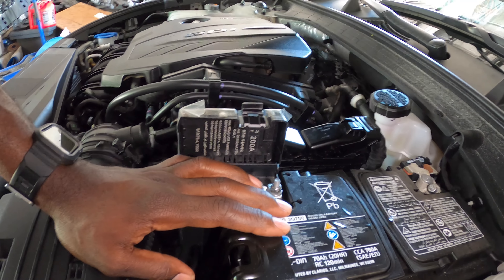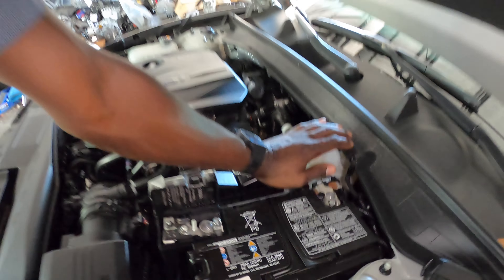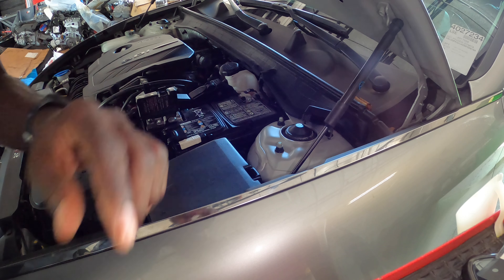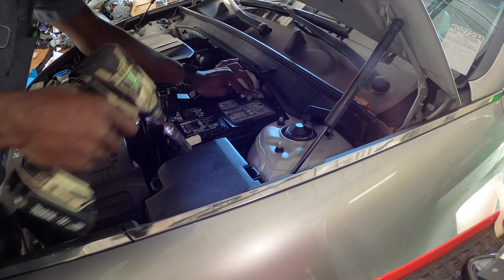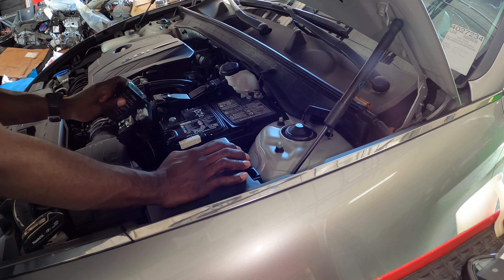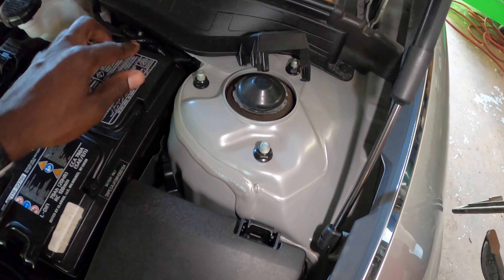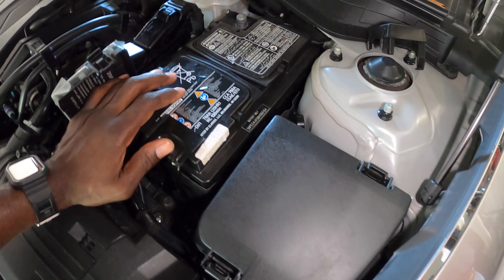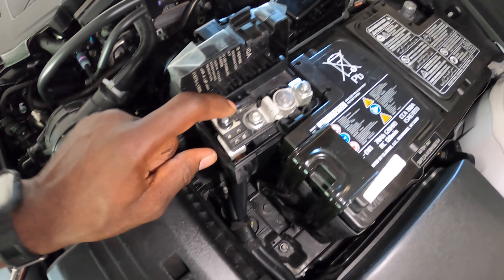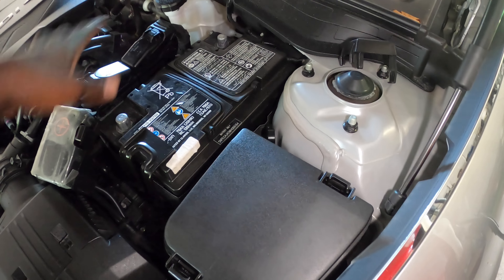If you're really careful you can take off the positive terminal first. But if you don't feel like being really careful, you can just take off the negative — it's safer, but it doesn't really matter. We're gonna start with the negative cable. The reason it's safer to take off the negative first is because the rest of the car is negative. So if you touch it with the pliers nothing happens because it's just negative. But if you take off the positive first and touch a metal part of the car, it's gonna spark and probably blow this main fuse right here. Also if you jump your car wrong it's gonna blow this main fuse too. That's why a lot of people say take off the negative terminal first.